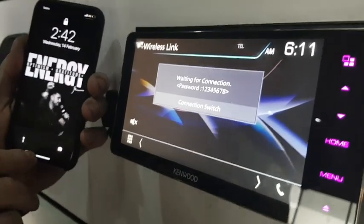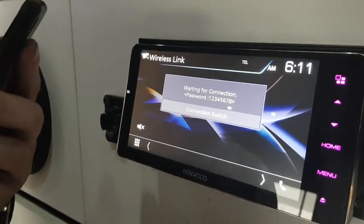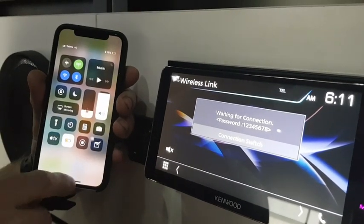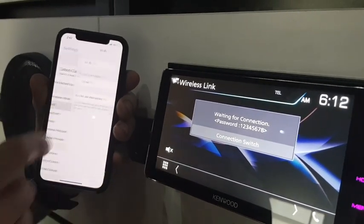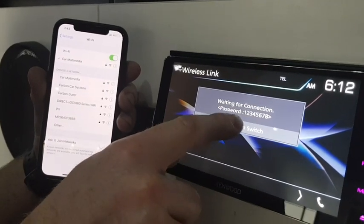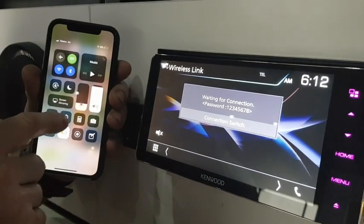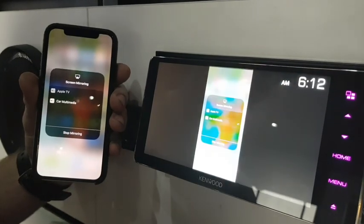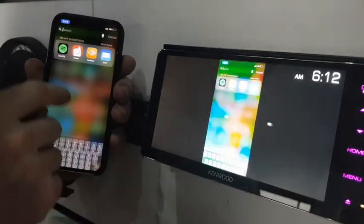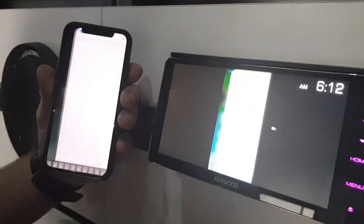I'm going to show you using one of the new iPhone X — the iPhone 10 — running iOS 11. What you want to do is pair up your Wi-Fi. Go into Settings, go into Wi-Fi, and it will come up as 'car multimedia.' Tap that and pair your Wi-Fi. The password is on the screen — it's one through eight, so 12345678. It will pair up, then go back to the main screen and turn on screen mirroring. Tap 'car multimedia' and there you go — you can see it mirroring straight away. You can turn orientation off on your phone since it is a direct mirror, and you can use things like YouTube, Waze Maps, Google Maps, or anything that's not native to Apple CarPlay.